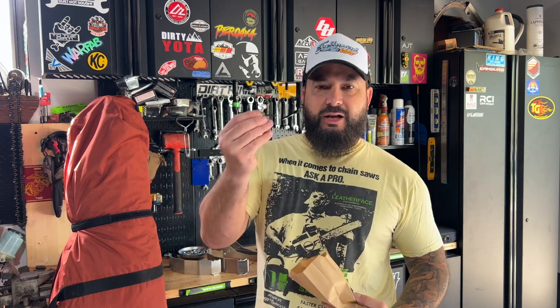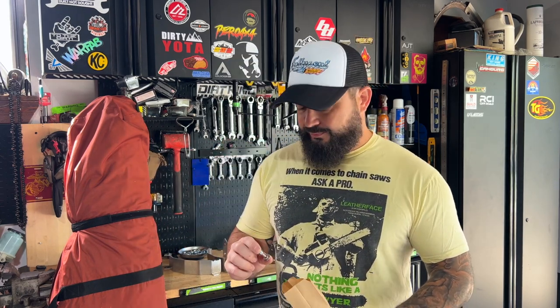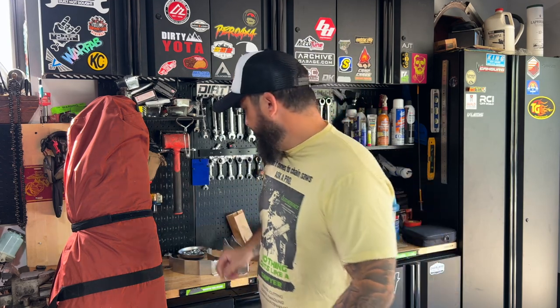I have to go through a little more than maybe some people would, depending on what you have on your rack. I have cases already in there, so mine goes down the middle — my cases are bolted in. If you're going to put it on the front tube, I'd suggest picking up four quarter-inch carriage bolts. This is quarter inch, so it slides into the front tube. Lengthwise I got an inch — if they had three-quarter I might have gone that, but it was either half inch or inch, and the half felt too small. They also include longer bolts for mounting to a bed rack, but those won't slide into the slot on the front tube. I like the carriage bolts because they not only slide in but lock with the square.